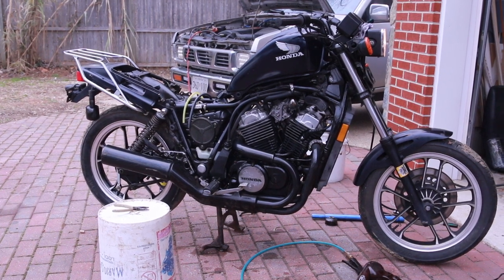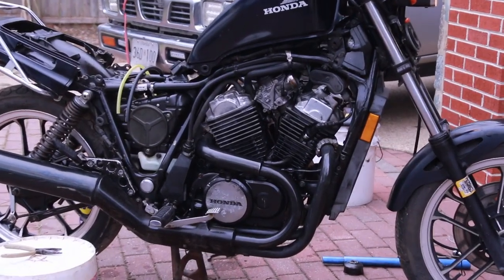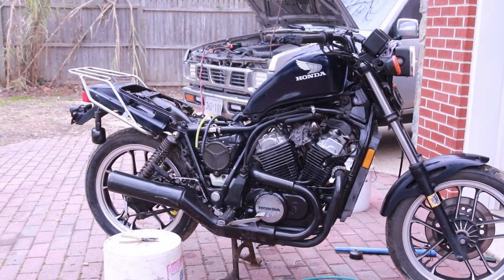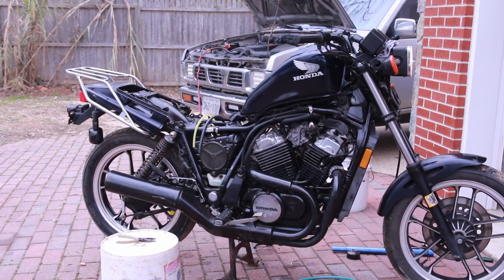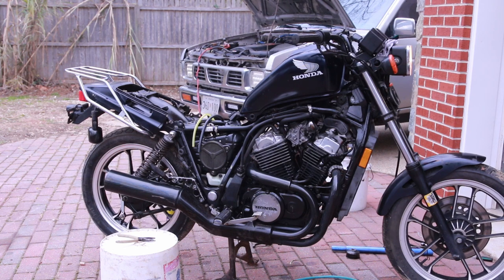I think it might be burning a little bit of oil. I was cleaning the engine so it is kind of smoking. It's smoking a little bit but I'm surprised that it works. It goes into gear. The engine seems strong. I think the issue is a little ticking from the engine — it might be the valves that are out of spec, so I'm going to look into the valves probably tomorrow. Since it's working now I can order some parts like the fuel.